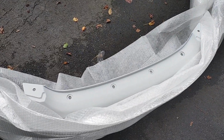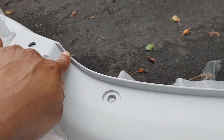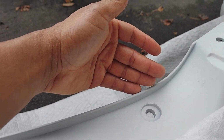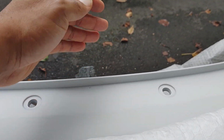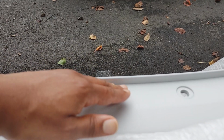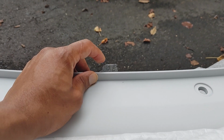to cut the lip off this bumper. Let me show you. So here's the lip that I need to cut off. I need to cut that off. And this lip serves no structural purpose other than to block debris from hitting the condenser. So generally, when you close the lid, the bottom of the grill sits like right here, and still things could pass through there. But since mine is actually sitting flush now up against the bumper, this is no longer needed.